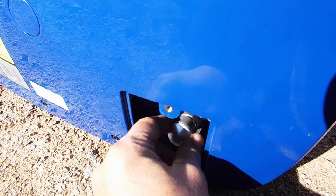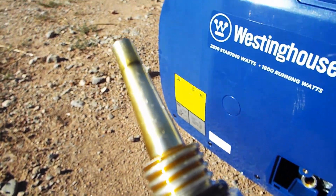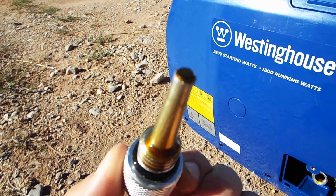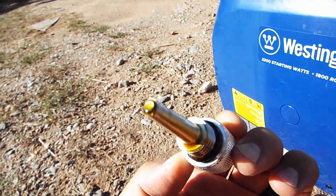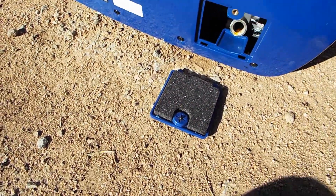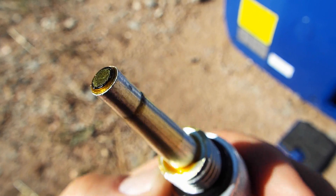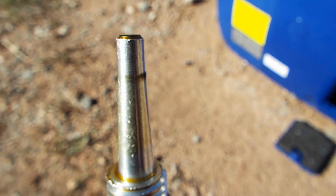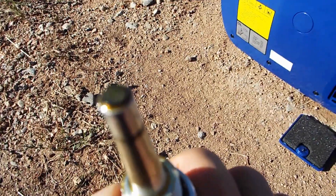Let's take it out and see what we got. Just a very small amount of black on the end of it. I'm going to take the oil off of this and we'll look at it under a microscope. There's a little black around the end of the ring here too, so it does look like it's capturing some metal. Let me switch the camera to macro mode. You can see the black all around the end of the magnet, and on the edges around the top where the end of the magnet is. The magnet is only like a couple millimeters long.